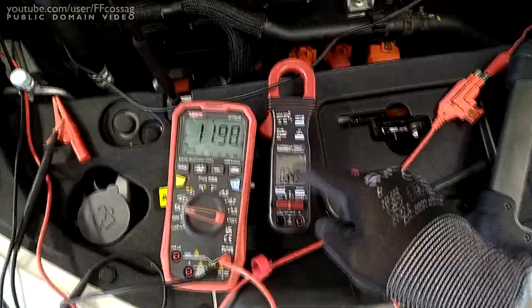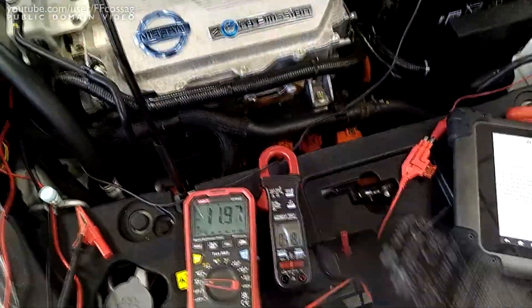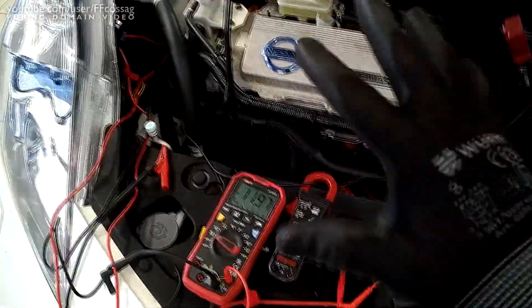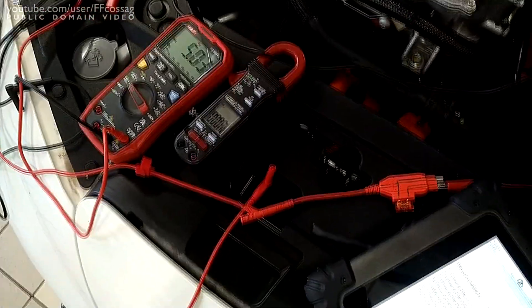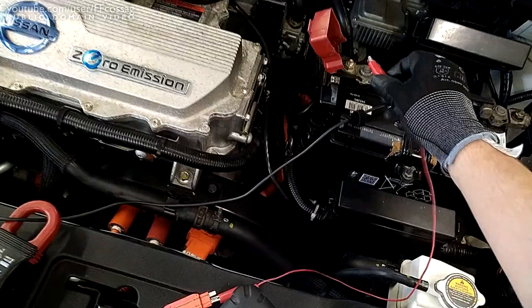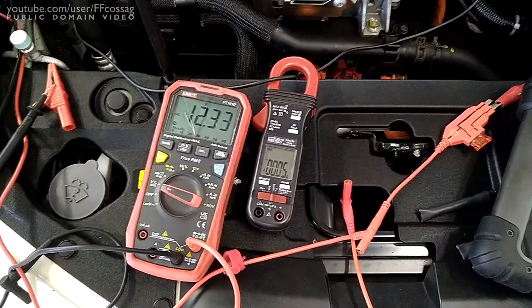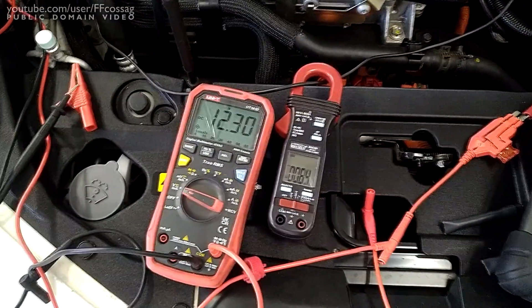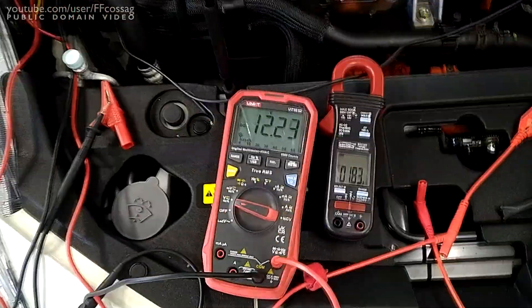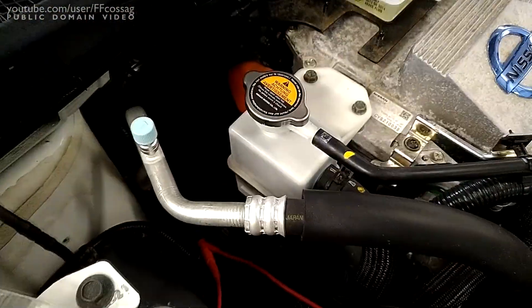Check this out. Currently the pump is running. We have the voltage down to the pump and the current into the pump — we're just running it manually. The car has nothing to do with the pump; it's just to discharge the battery. You can see it's running just fine. If we disconnect the battery and plug it back in, it'll take a few moments, and there you can see the current jumping up. The pump starts up just fine — doesn't sound bad, sounds completely fine, doing its job, circulating the coolant.